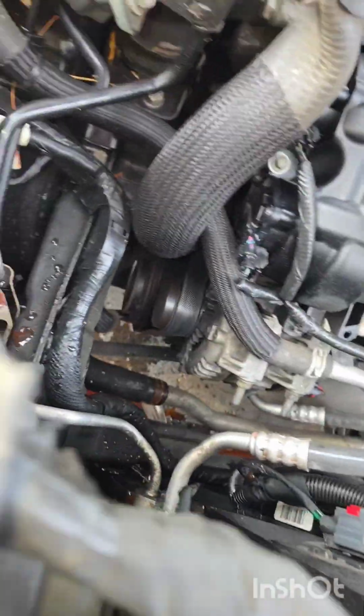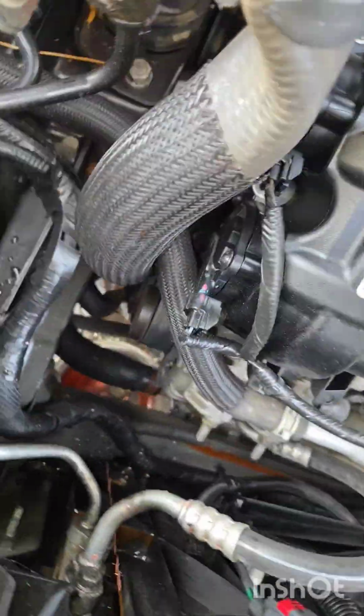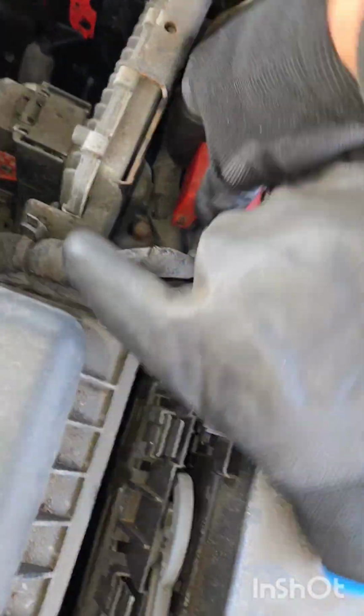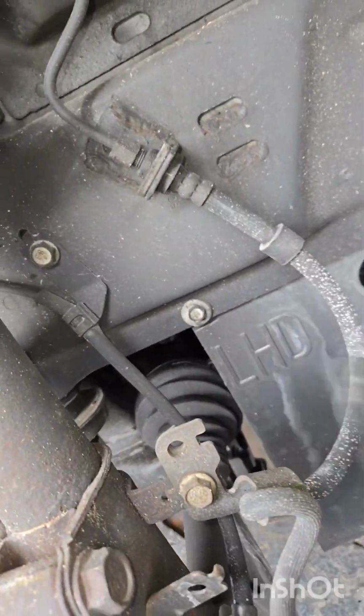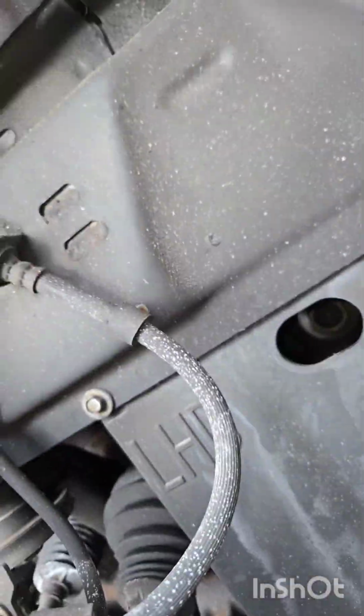I'm gonna write down the diagram for my belt. Take off my wheel, and then I'll loosen the tension of the tensioner, remove the belt, get this old alternator out, put the new one in. I'm gonna disconnect the power from here, and just be very careful not to touch anything over there. Wheels off. Now I'm gonna remove these 2 10mm right there. This plastic tab and the shield should come off. Our tensioner should be right there.